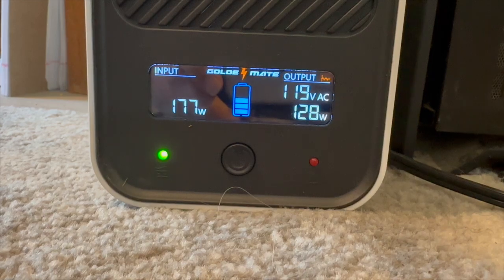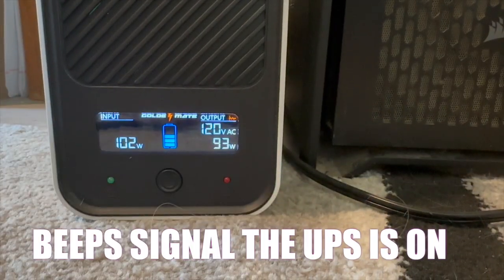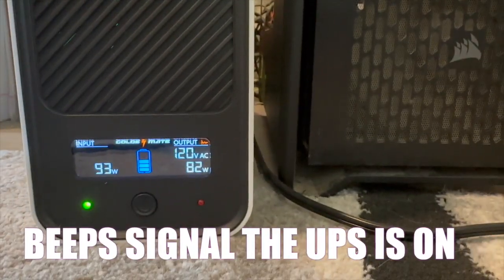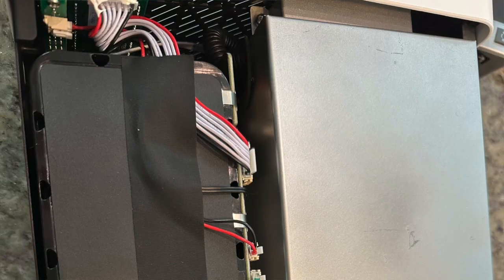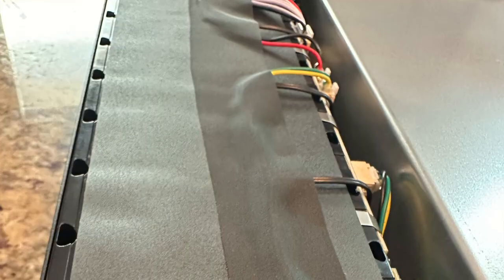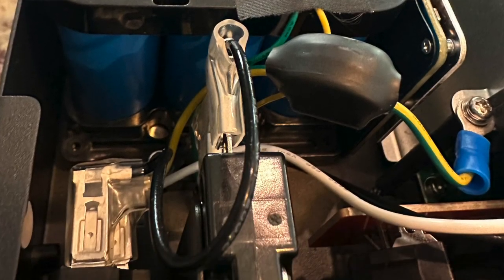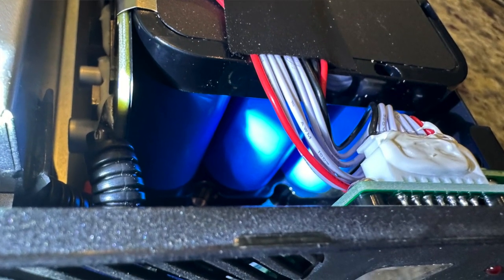After that test I decided to hook it up to my own desktop computer with monitors and a light. I pulled the plug to see how long it would run, and after well over an hour it still had well over 50% showing on the battery indicator, so I just quit then. I was curious about the battery technology inside, so I took it apart. The battery system consists of 24 26650 cylindrical LiFePO4 cells wired in a 3P8S configuration, providing about 25.6 volts of power.